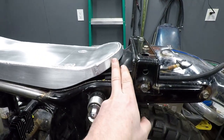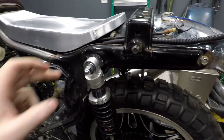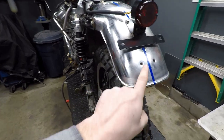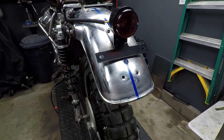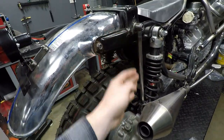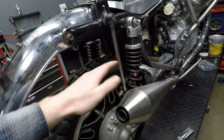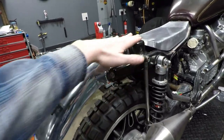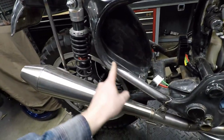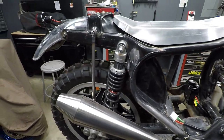Another consideration is fitment around the seat. I'll probably start with this flat surface here, welding a plate to the front and then building everything off of that flat plate. We have a tie point here, a potential tie-in point here, and I want to tie in the lower extremities of the racks for some lateral support — tying into the fender here, and then we can cover that with a license plate. That whole section will be removable. Over here we've got to work around the exhaust, so I might keep the rear hanger or make an improvement. I'll build in a little tray that comes up a bit higher and maybe some heat insulation from the pipe. We'll also build in some tie points for straps — to make it easy to adapt any gear you want.